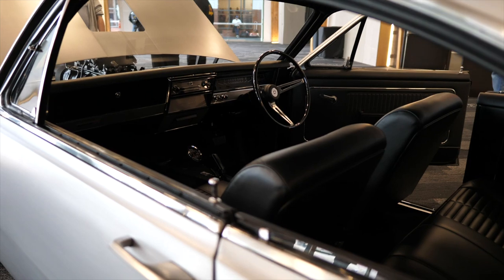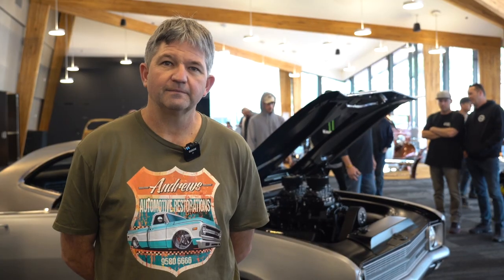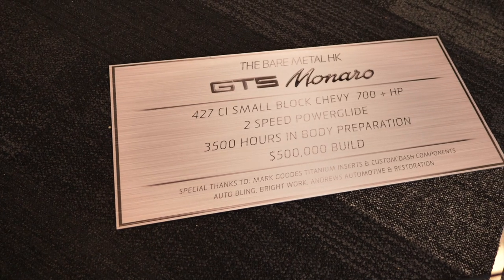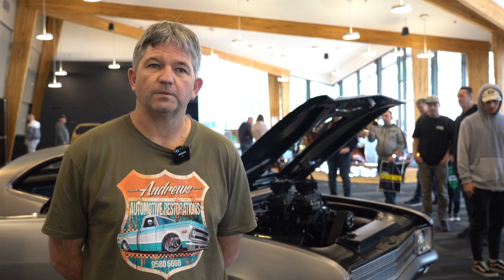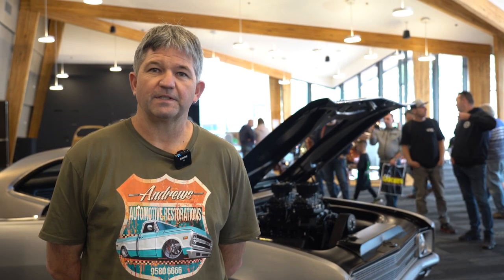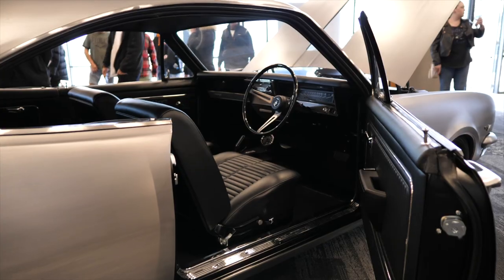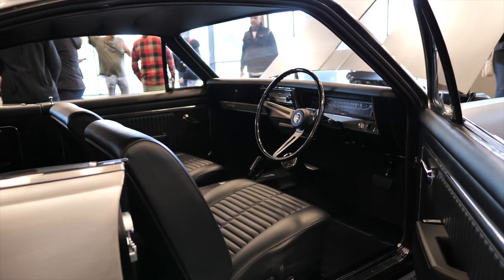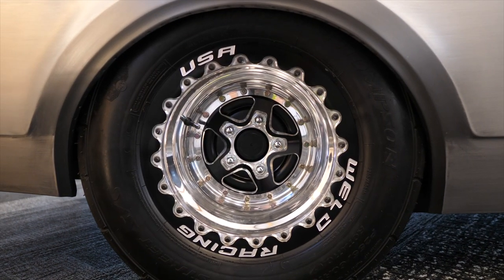The car came to us about two and a half years ago. It was an original car painted with the drive train you see in it now. We basically took it from that, stripped it down, and as you see today — originally it was to be painted, but during the build things changed. We had some ideas come up and decided to make some modifications, delete some seams and bits and pieces, and turn it into a bare metal car and leave it bare metal for the moment. The engine's a 427 Dart block with the blower and twin carbs, running a Powerglide transmission and a Strange nine-inch rear.